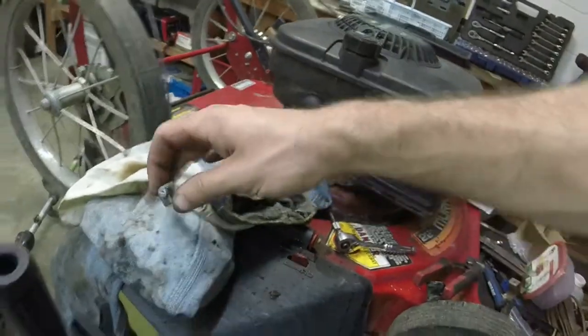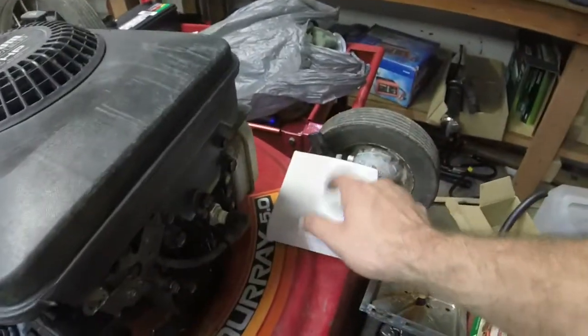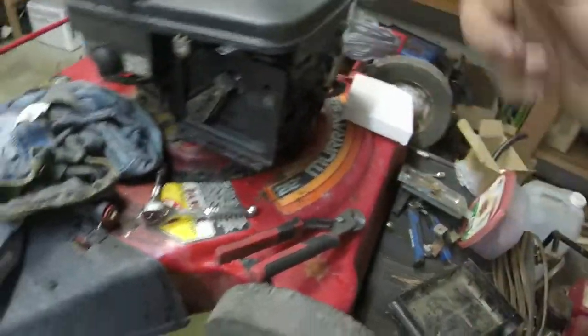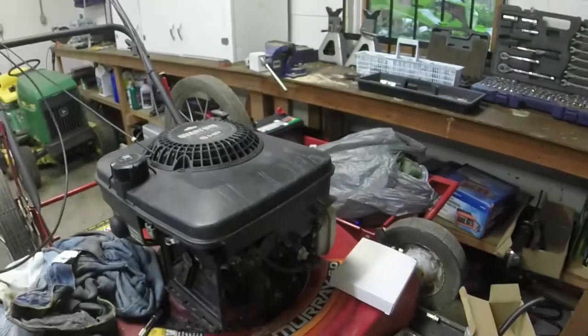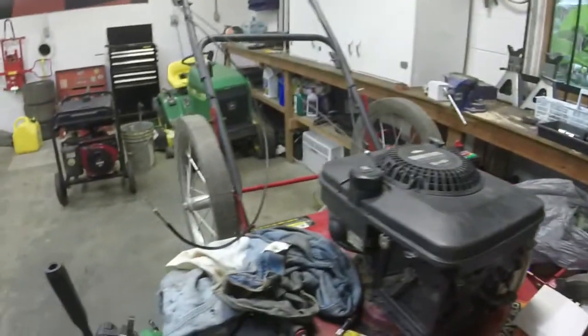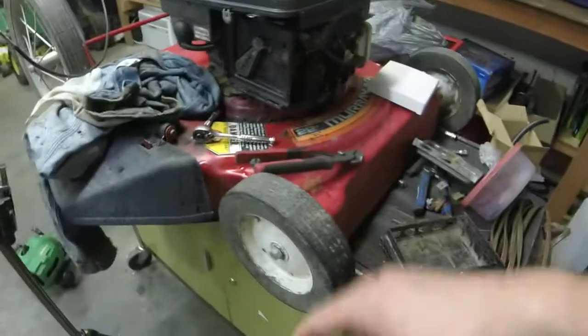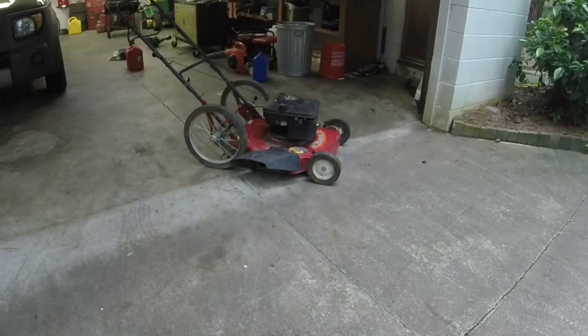Let me take the throttle cable off and just clean up my mesh real quick — I have an air filter for it right here. I'll put on the cover and get it ready. I've got some gas in it. These old five-horsepower engines are really quiet usually, so as long as I've got the throttle deal hooked up right we'll have a good lawn mower here. People love these bicycle wheel Murrays — this is by far one of the best conditioned ones I've received. Even the wheels are tight; usually the front wheels have so much play in them, but these bicycle wheels are the ticket.